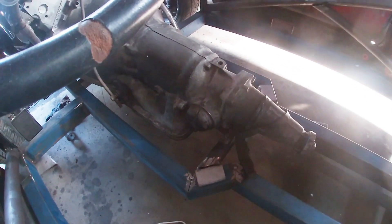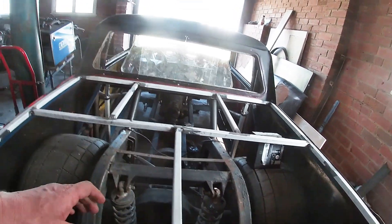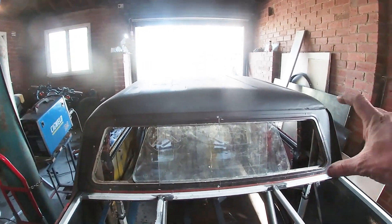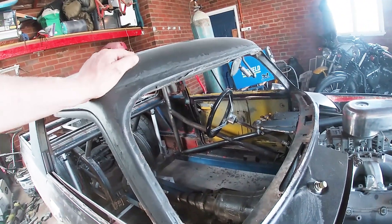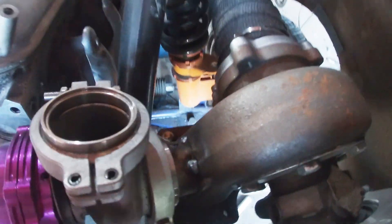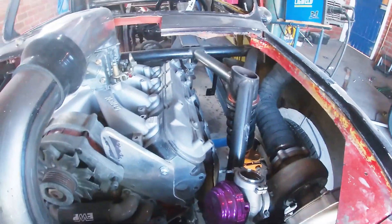I made a little mount for the rear of the transmission there. Re-mounted all these actuators out much wider this time - changed all that. I've made my little cover here for the rear, just put a slight bow in it to aid water coming off it. I'm going to cut some perspex for the rear there for a fixed center panel and then some little steel strap supports that go there, just to tie everything together. I'll probably do a steel support down the center there, sort of NASCAR style. Put the wastegates on - you can see there, just tacked into the little J-pipe thing. And on this side to get it semi-symmetrical I had to just tack it into the exhaust housing. So I'll pull that all apart, take that exhaust housing off the cartridge, heat it up in the oven and weld it.